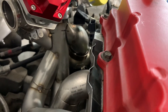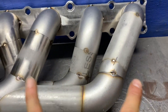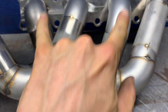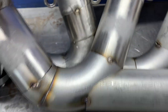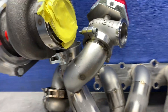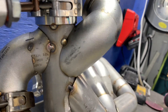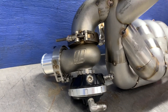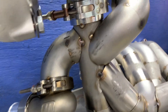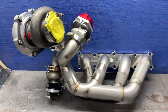Then on the other side you have the fresh air anti-lag. So this is a four-to-two-to-one — these two connect back there, comes up to here, right before the wastegate. Should be pretty solid priority, comes out at a decent angle, and then over here we have the fresh air anti-lag coming up. So we will see how it works.